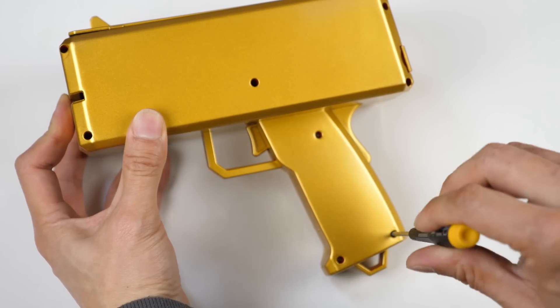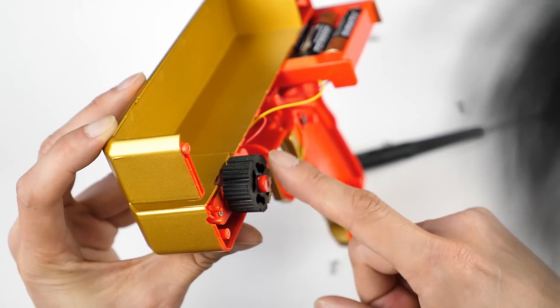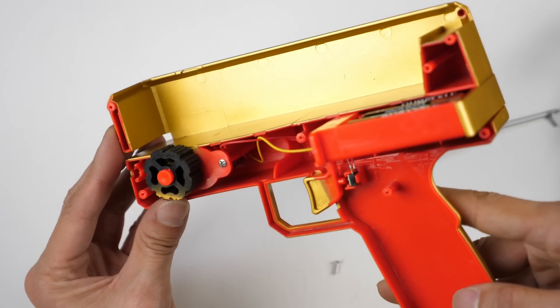Right now the bill is caught here because it's slanted upwards and can't come out of the exit hole. I'm going to proceed to open this thing up. There's a DC motor here and one gear reduction — pretty simple thing where the switch just connects the battery power to the motor.